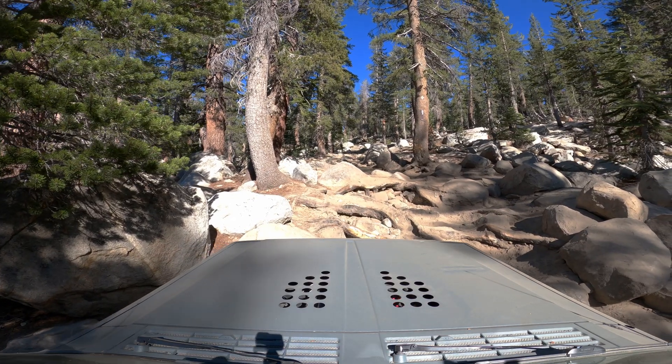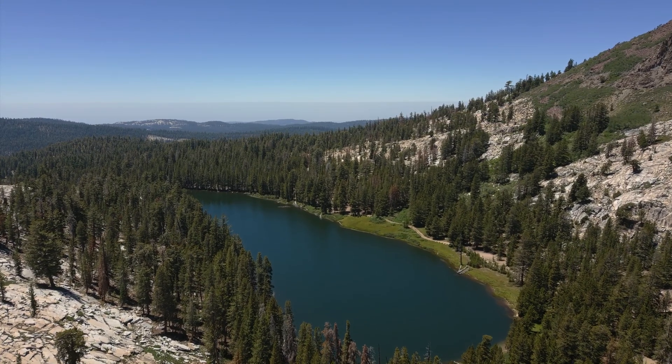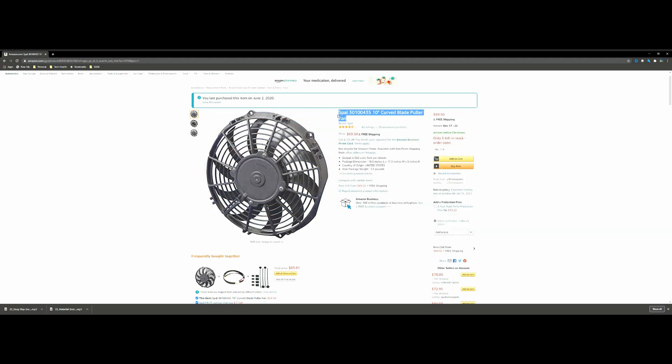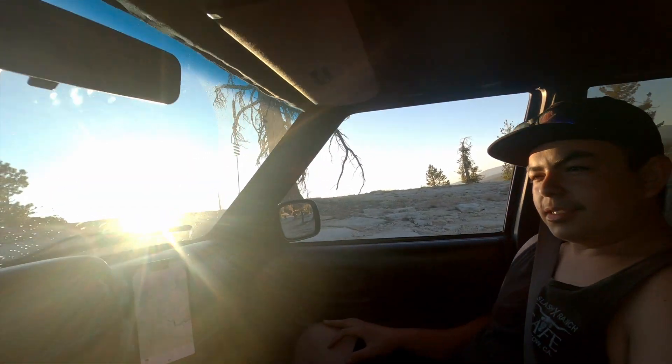If I can give anybody advice when looking at doing a 4.6 stroker, I highly recommend going through your entire cooling system. Even if your AC condenser looks good, you're already in it for the stroker and your costs are already there — don't try to save $150 to $200 on the AC condenser, just do it. Go with the SPAL fan; don't trust the TYC. Maybe it's fine for the stock 4 liter or a lighter Jeep, but essentially I'm towing a trailer everywhere because of the weight. So that's the update — thanks for watching. I highly encourage you to do the build. Get a hold of Russ Pottinger, get the kit, and you'll be completely satisfied with the extra power in your Jeep.